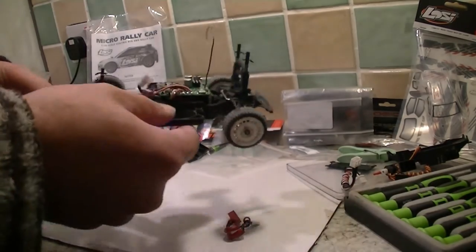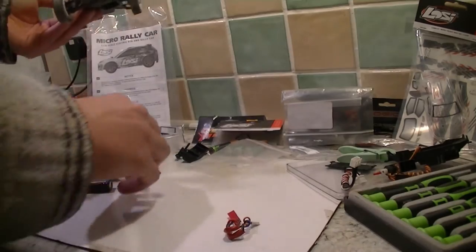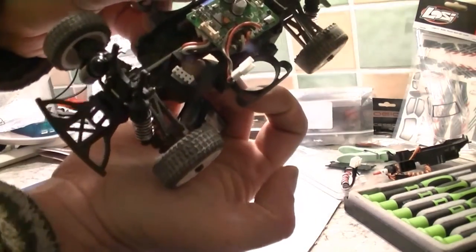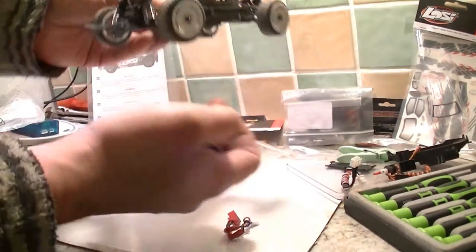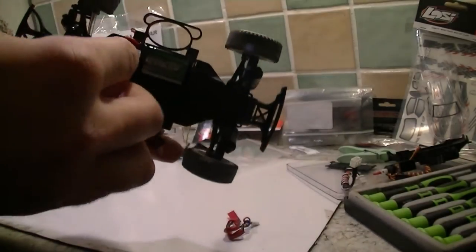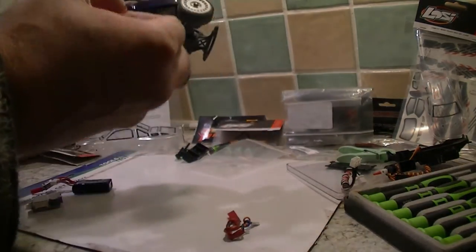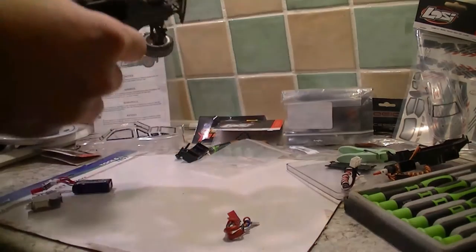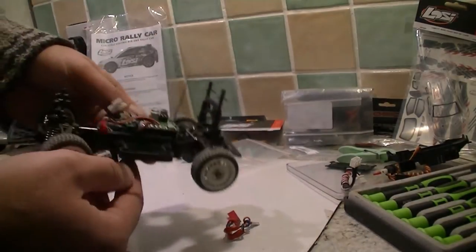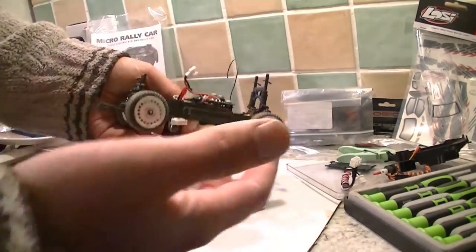To do this I've had to actually modify the chassis. Before, there was a little bar in between here which I've chopped out so that the balance plug will fit inside there. It's giving me a bit more room in there. It doesn't really take up too much room when it's in — it's got the balance wires and all that. Good fit anyway. About the biggest 3S you can get for these. Basically what happens is I'll plug in the battery there, the balance plug comes out the top and connects to the voltage checker, and that will run out of the side of the chassis so when the body is on you can still change it.